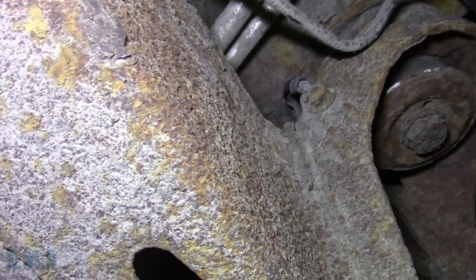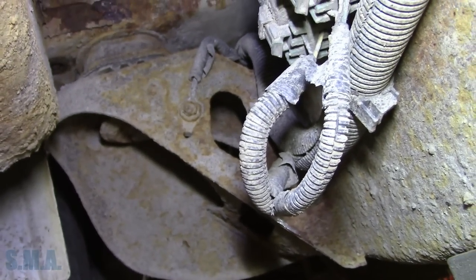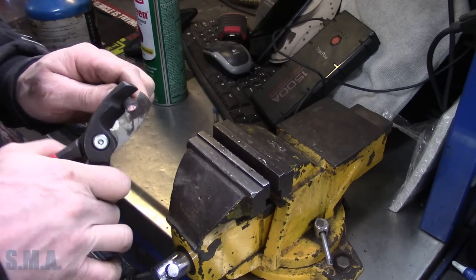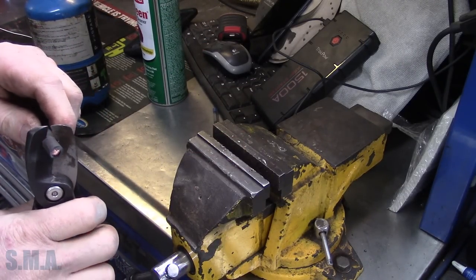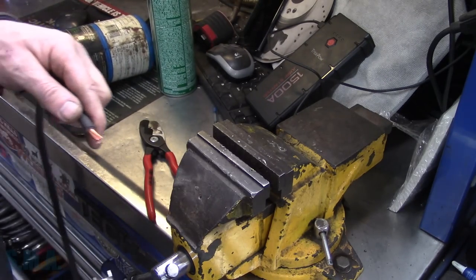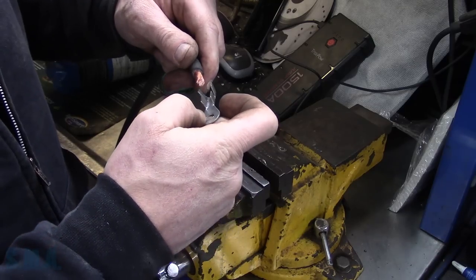The one for the fuel pump is actually that one right there. When we were outside doing the voltage drop test, we were up here in this area — the whole frame rail is not grounded. Lucky for this fella, I happen to have some battery cable here that I think will work just fine. We'll get the insulation cut on it. I've got this eyelet here that we can stick on there — we'll crimp it on and solder it just to be on the safe side.